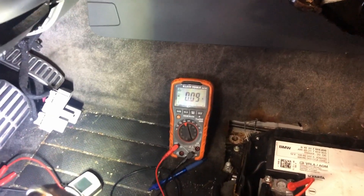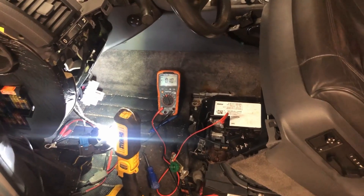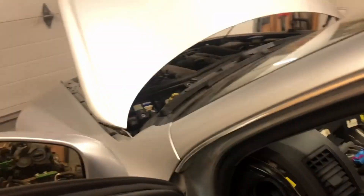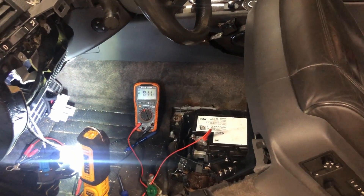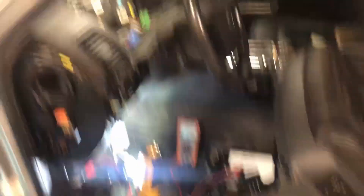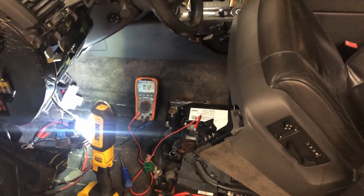I'm going to basically let it sit for a couple days without setting up the min/max on the multimeter. It's basically setting the alarm off after about a day or two from a dead battery, so hopefully the alarm doesn't go off. We'll come back in a couple days and see what the battery voltage is sitting at. Hopefully this helped you — I should have a couple more videos coming, including a cluster repair and cluster diagnostics. Thanks for watching.